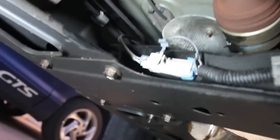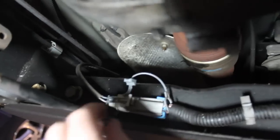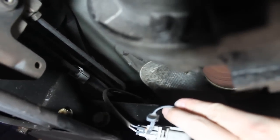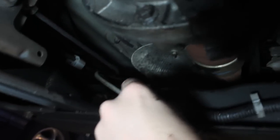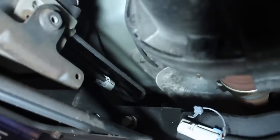And that is the next step here — we're going to follow these wires back and disconnect them. After looking at the passenger side, I took a closer look at the driver side and you can see the rear O2 sensor over there, and the connector on this side is extremely accessible. Here's what those connectors look like. This is what any GM connector will look like — in my experience these are pretty standardized. GM really likes these little connector arresters here that stop it from coming unplugged, because they do unplug pretty easily. You don't want that to come unplugged on its own. Sometimes these can be a little stubborn, sometimes they come off real easy. Just be really careful — don't break the tab. And there it is. Now we are ready to take a wrench to the sensor itself.